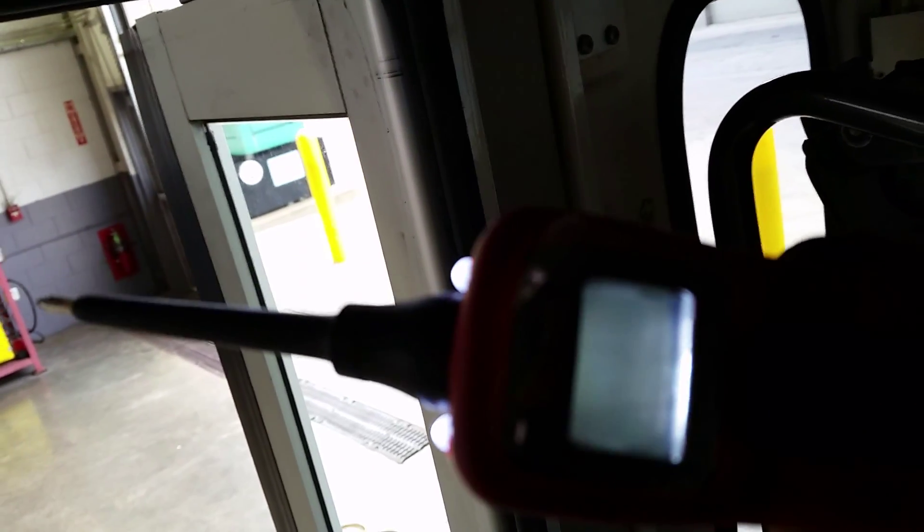What I did, just to see what was going on, I checked good power with my Load Pro and I did have good power — didn't have any voltage drop, and I knew that was good. So then I started checking at the module using a power probe.